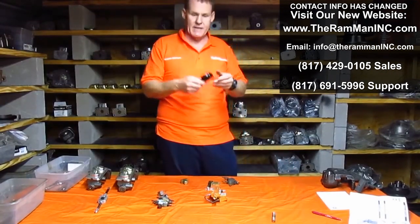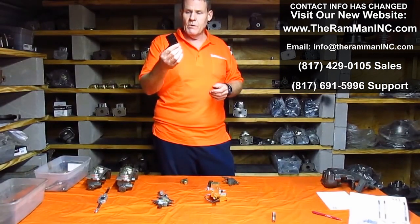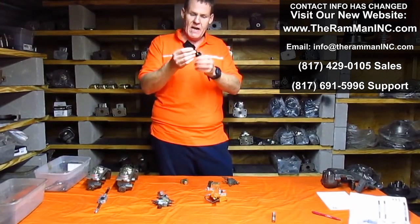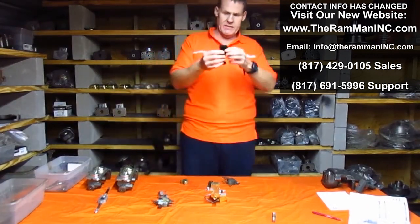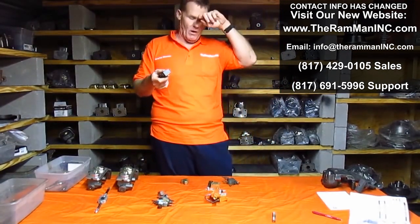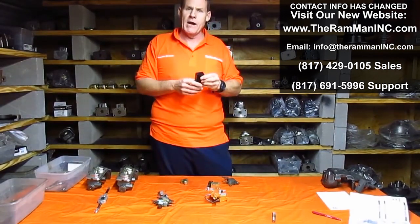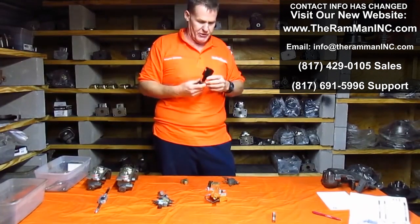That's a little breakdown of our factory valves, and then you run up against this little simple gizmo right here. This is what you'd call an adjustable valve. You can hook this up in-line on just your rear line, and it's got a thumb wheel where you can adjust the cut-in pressure and how it behaves. You hook this up on just your rear line, go out to your stadium parking lot or country road, and practice four, five, six, eight stops from 40 to 50 miles an hour. You dial it in until you get really good braking on the rear end but you don't get a whole lot of slides.